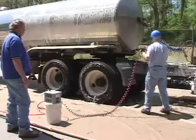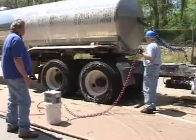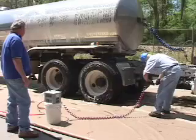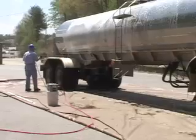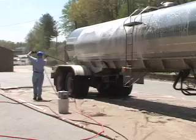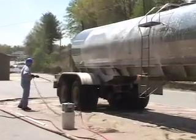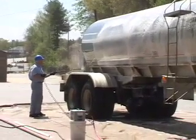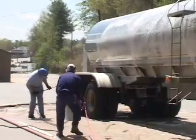The foam and everything that runs off of this vehicle hits this mat. This mat is really resilient — it puts up with anything except trying to cut it with a knife. If you're on a gravel parking lot you need an under-garment for it so that the rocks don't punch holes in it. This allows ease of recovery of your waste water and decontamination, which is going to be just as important as decontaminating the vehicle.